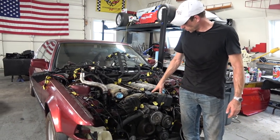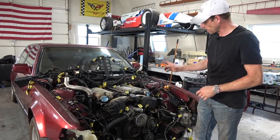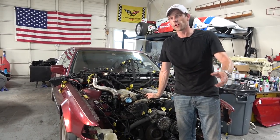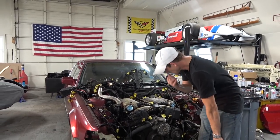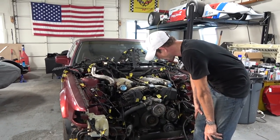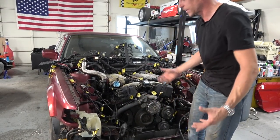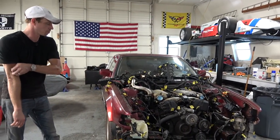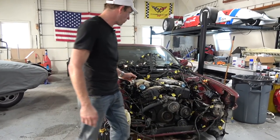The earlier M70 motor is similar in architecture to what created the McLaren F1 later, although there were massive differences between those engines. Still, it's a very nicely engineered engine. It's going to sound beautiful when I make some tubular headers with megaphones — all 12 into 6 into 2 into 1 into 2. It'll be cool. And the nice thing about having the radiator in the middle of the car in front of the engine is I don't have very far to plumb it. I can probably get a nice aluminum aftermarket radiator at Jegs or Summit — something like that for small block Chevys — it'll have plenty of capacity, good price, great performance.